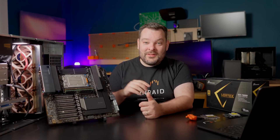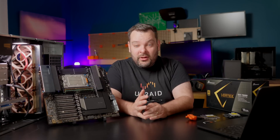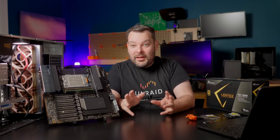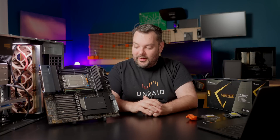The only other thing probably worth thinking about is memory. In the old Epic 7402 system, I was running 3200 megatransfer-per-second Samsung memory with ECC capabilities. Luckily for me — and this was a huge tipping point in the decision to go with the Threadripper platform — the 3200 MT/s memory is compatible with the Threadripper Pro and actually quite performant. Luckily, I didn't have to step up to DDR5 or anything like that.